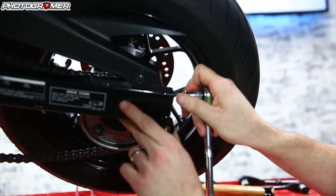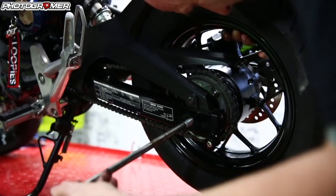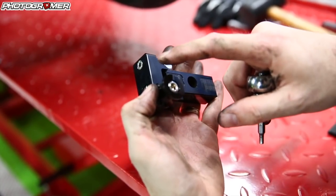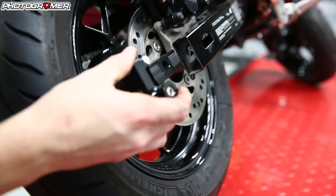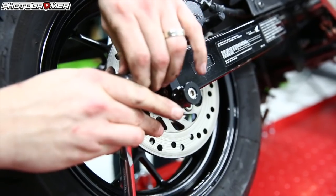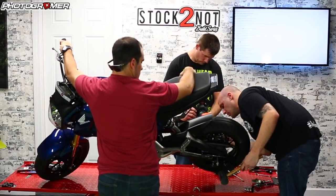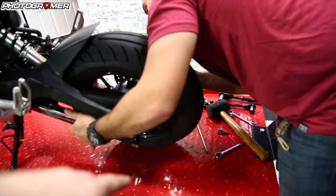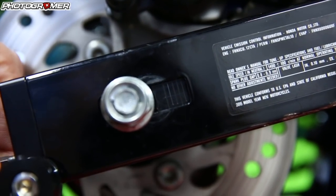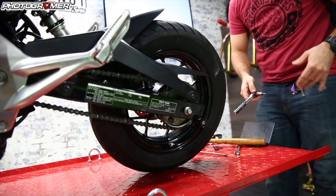We already have the spools in — they don't come with the adjusters, you have to buy those separately; links to all parts are in the description. Andrew says to tighten the bolt first so it puts pressure upward and locks into the swing arm. You just want to make sure you're lined up as well as possible so you don't sandwich the end of the bolt. It'll move the axle forward and backward as far as you need, as long as the axle nut is loosened. Make sure it's even on both sides, otherwise you'll get massive wheel wobble. All you have to do is tighten the axle and you're good to go — that's how easy it is.